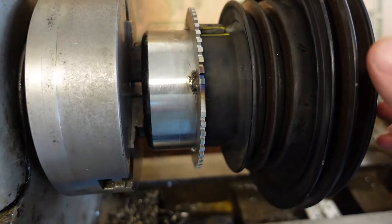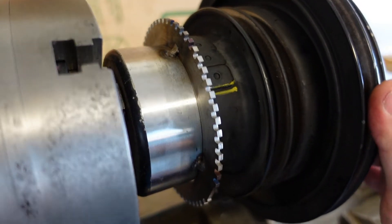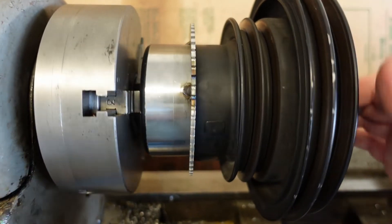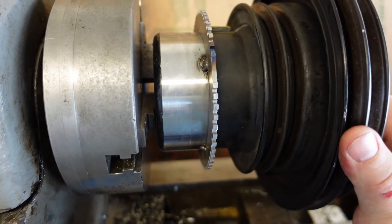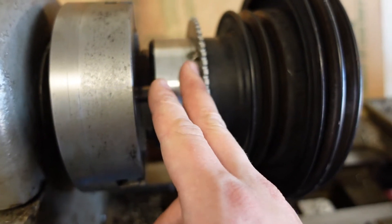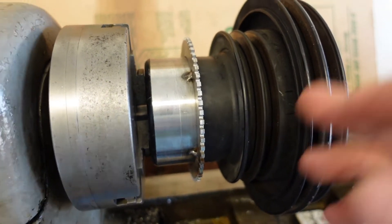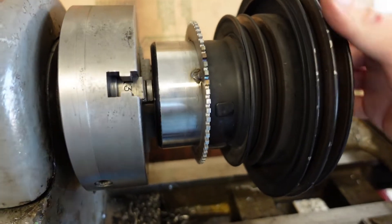I got the wheel tacked on as close to the weights as I could get it. It's just being held in four tack welds — that's probably all I'm going to put on it. It's decently straight; I did my best just with some calipers, but I'm going to have to take it back to the machinist at work to mount it in the mandrel he made. We can get it a little more straight just by tapping it with a hammer to get all the teeth straight, and then take a light cut off the diameter to true it up to the axis.